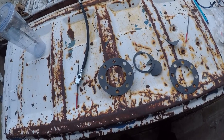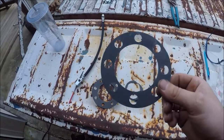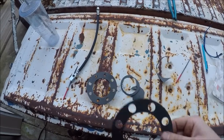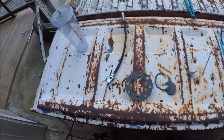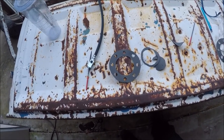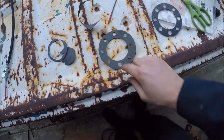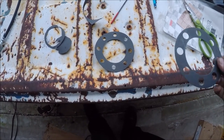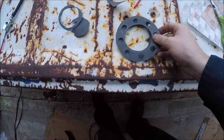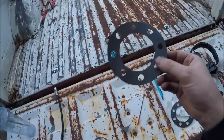We'll pick back up on this when I make more progress. I'd actually forgotten all about this earlier — I said I was going to do this first. I ended up welding that tab and working on brake lines. But here's a metal gasket like you'd buy at the parts store to go on the end of the axle, but I only have that one. And honestly, that makes a pretty nice template. If somebody can just smear some RTV in there and it not leak without even putting a gasket in it, then this nice little homemade paper gasket I just made with a little bit of paper-thin layer of gasket maker on it will probably work great.